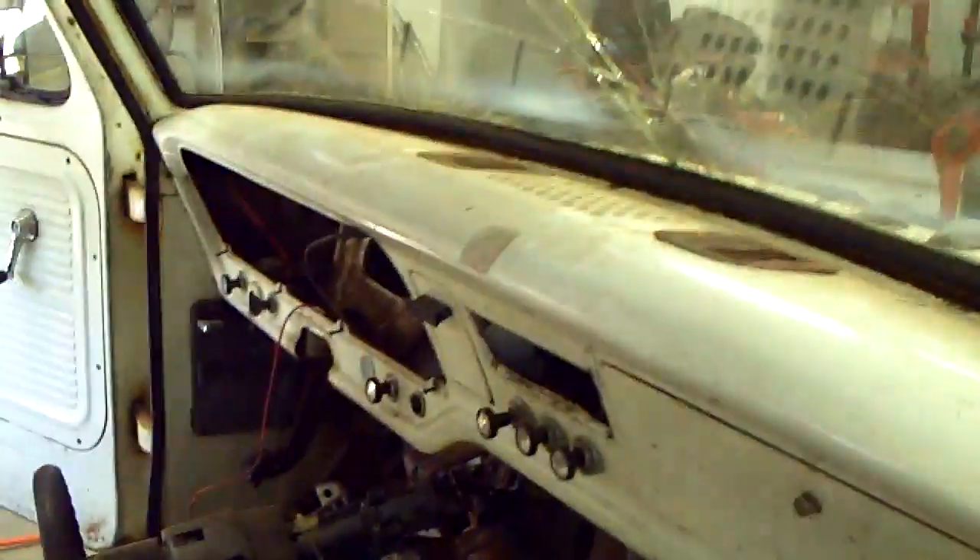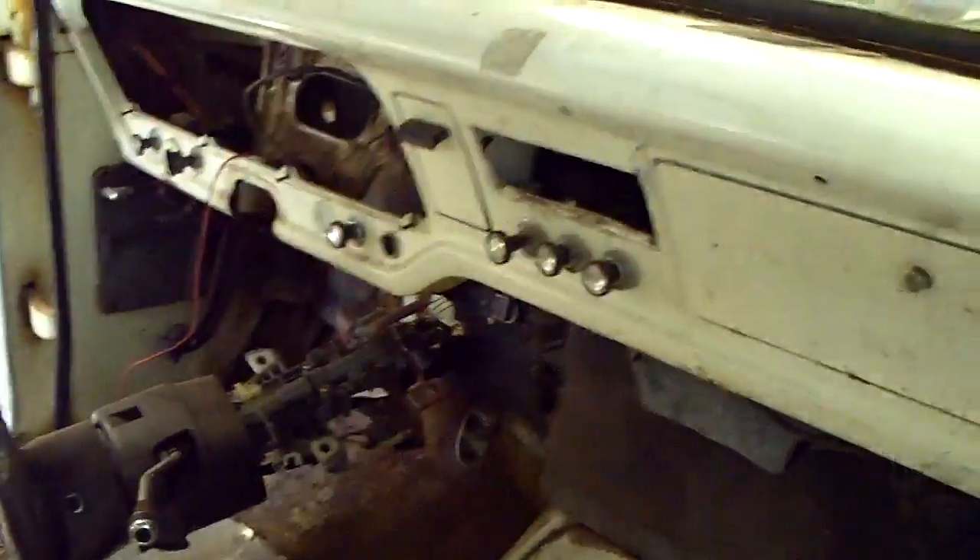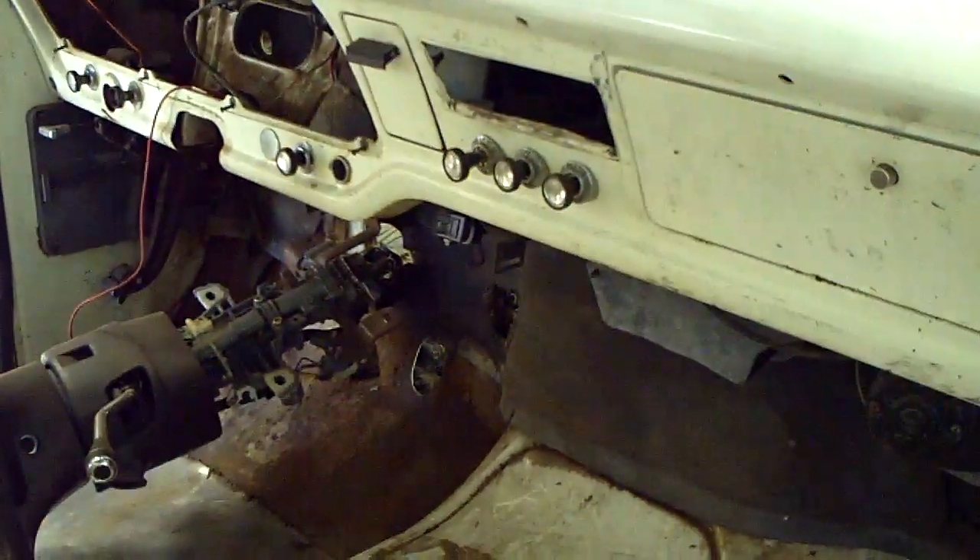In the interior, we've taken out the seat and seat belt, and removed pretty much the vast majority of the wiring harnesses, with just a few exceptions. I cut out all the rusty part of the floor board that was on the passenger side. There's still some more metal I need to replace right over here on the kick panel, at the bottom of the kick panel.